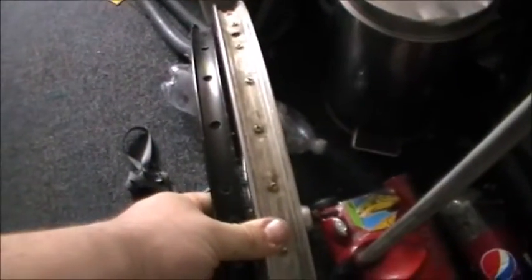Because if you have more tension on one spoke and not the others, you're going to buckle the wheel, and then you've got to sit there and try to straighten it out — it's a palaver. I better put some tape round that rim. I've got the original rim tape and a replacement one here, but I think I'll put some PVC tape round — that's my cheat. It's quite a wide rim. When you compare it to a more modern mountain bike rim, you can see the width difference. That's another reason I wanted to save them — I think they were worth saving.